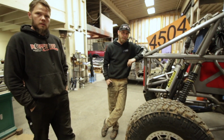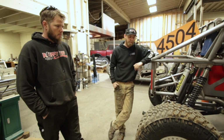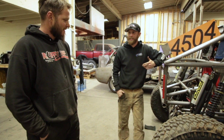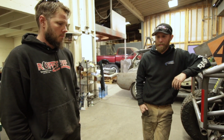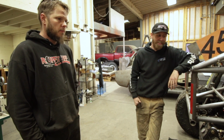So you guys raced in the 2018 year quite a bit. What were some of the worst breaks that you had? First race, we broke 3 front stub shafts. Oh, and 3 that's spindles. Right. Our first race, we blew out the front end 3 times. The Dana 60/30 spline stuff does not last long at all. It was our beginning race.